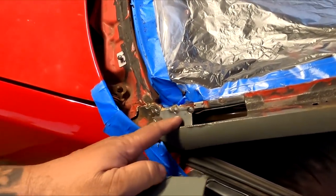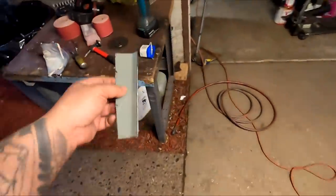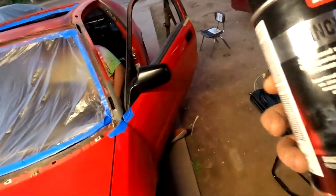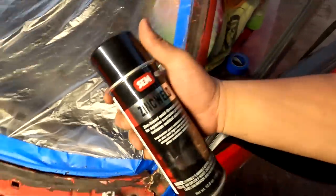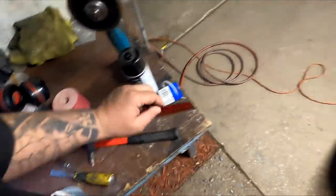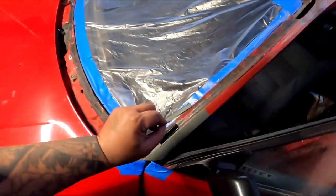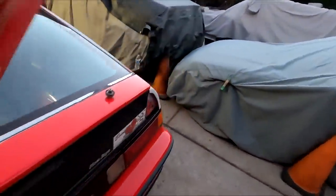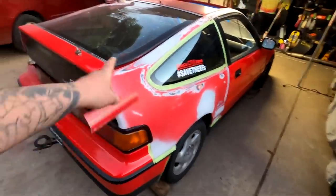Pretty much all I'm going to do is measure it up, close tack it in, and then just kind of massage it in until we get it nicely fitted. I do have some zinc weld-through primer — this will allow primer to be applied to the inside and everything, and the weld will still weld through without blowing through. I'm going to be using this for the inside before welding it up. I'm going to form shape this into the channel — I'm not going to show you guys the whole process because this is going to take some time, but I will show you guys the after.